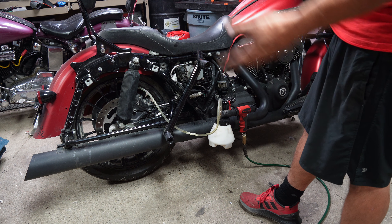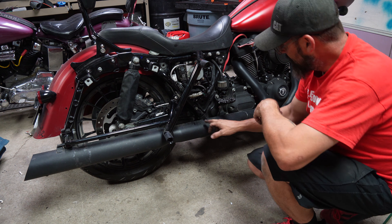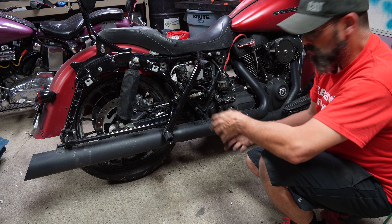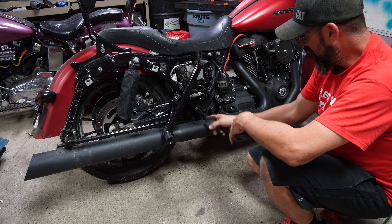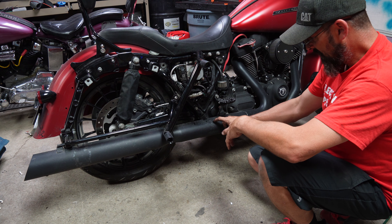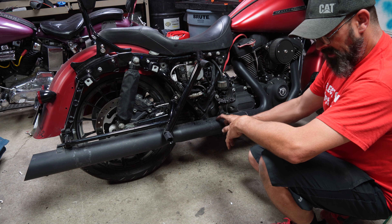Super simple on the DT2, but it's going to cost you a bit of money. Obviously, you can see I got brake fluid on some of the painted surfaces, which was an accident. So I'll wash it off with my alcohol water mix. You want to try to get it off there as soon as possible so it doesn't have a chance to eat at the paint — yes, even powder coat.